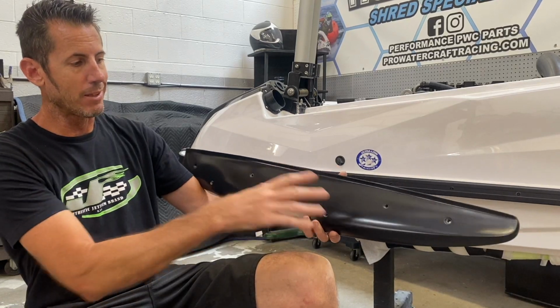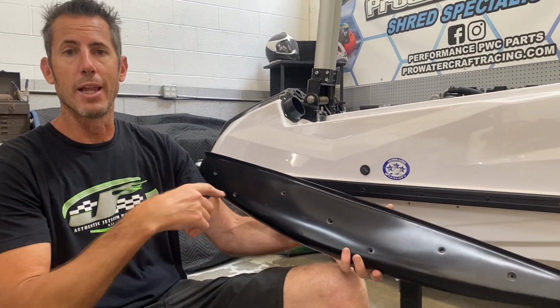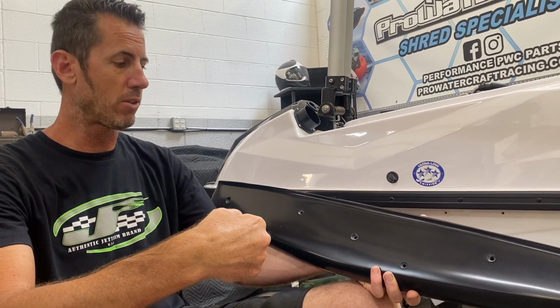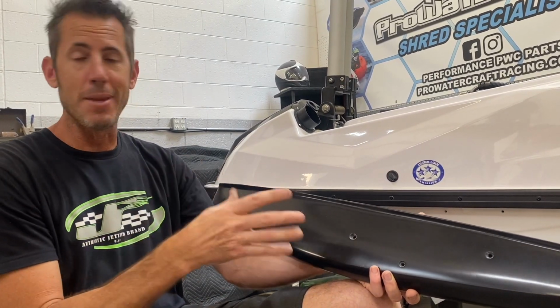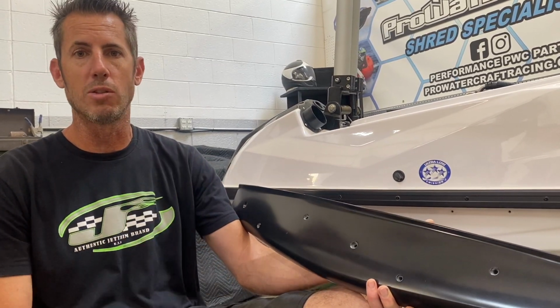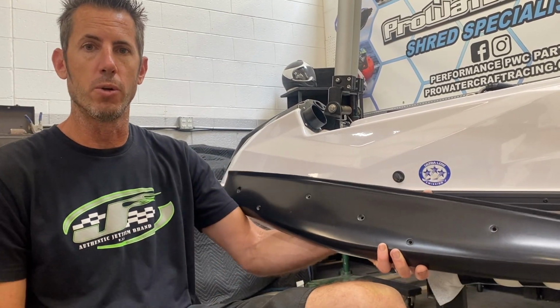So I like the 7 screws, or the drill and screw method, because I don't have to reach to the inside of the ski. It's all from the outside. It's drill, screw, silicone, clean it up. It's a really simple install, and I'm going to show you how to do it now.